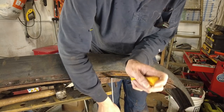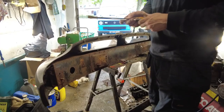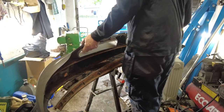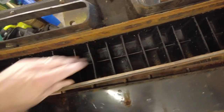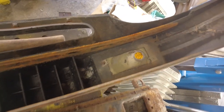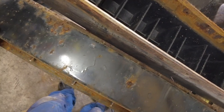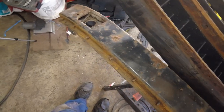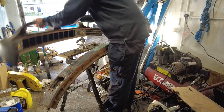What we now need to do is try and pry the rubber up off the steel — I'm hoping the frame of this bumper isn't like Swiss cheese underneath. The trick here is you need two implements to sort of walk along with them. I have the rubber pulled up off all the rivets now, so now it should literally just be a case of separating them. So obviously this is the inside of the rubber part and you've got all of these ribs. And this is the steel support that goes in behind it.